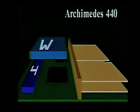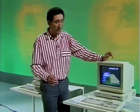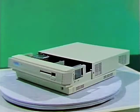Whilst the 410 can be upgraded to the 440, there's no upgrade path from a 300 series machine to a 400 series. The 400 series has a totally different circuit board. For one thing, it can support a very high definition monochrome monitor, giving a resolution of 1280 by 976. So the 400 in particular is seen as being used in computer-aided design work, where high resolution is essential. So that's the range of machines which extends from the 305 up to the complexities of a 440. Now you know what to look for, let's get inside a real machine.